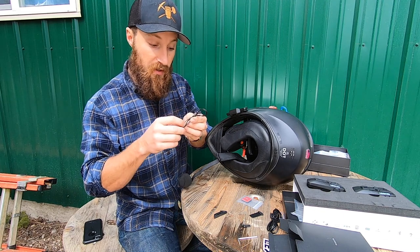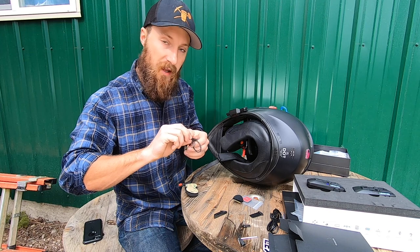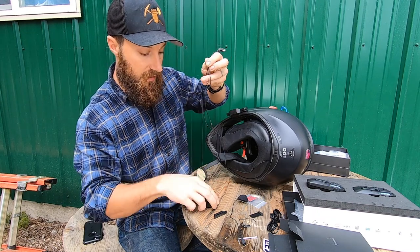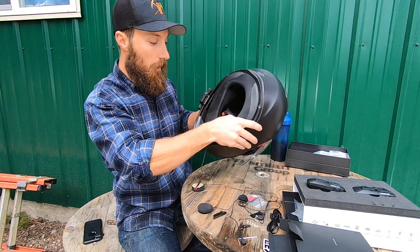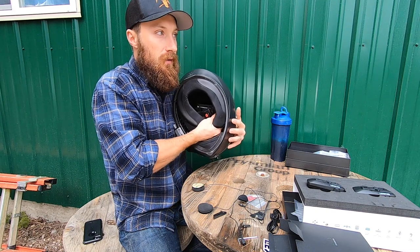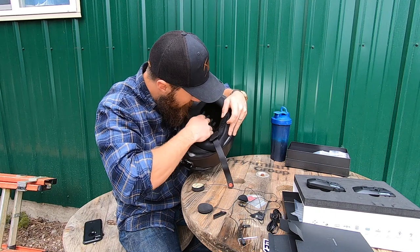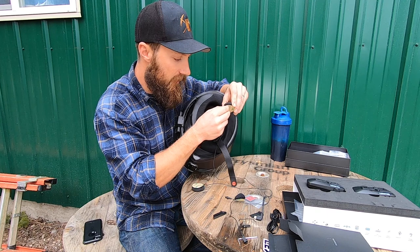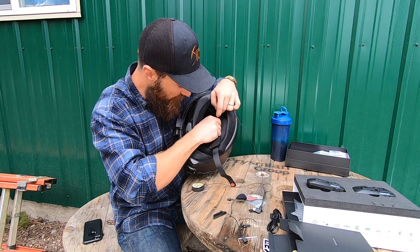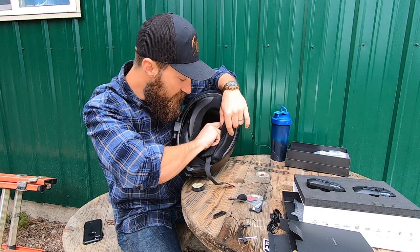We have plenty of wireage here. I'll disconnect the microphone for right now just to make it a little easier — eliminate variables is my mantra. Obviously you have a long and a short wire; the long one goes around to the other side of the helmet, so let's do that one first and work our way back. Close the visor, reach in here, unsnap your liner so that you can pop it out of the way. I want to route that wire in behind there, so I'm also going to undo the back one, take the adhesive off the back. Point the wire the direction it's going to be running. This adhesive is not a joke — press it into place.